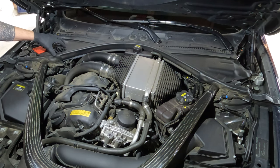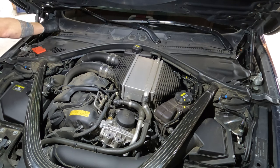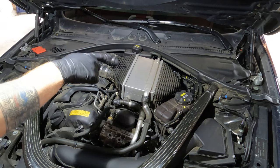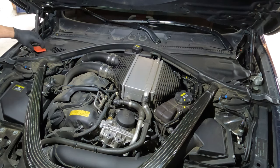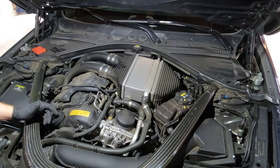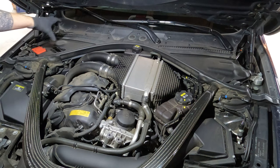We also need to remove the plastic covers up here. These are 10 millimeter quarter-turn nuts, so just take a socket or a wrench and quarter-turn each one. You've got a plastic rivet on each side — pick the center pin out and then pull the rivet out. Also note your positive battery post is here, so put a rubber glove or something similar over the top so you don't accidentally touch it while moving the carbon strut or tools around.